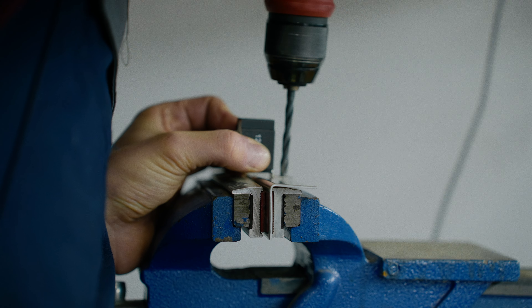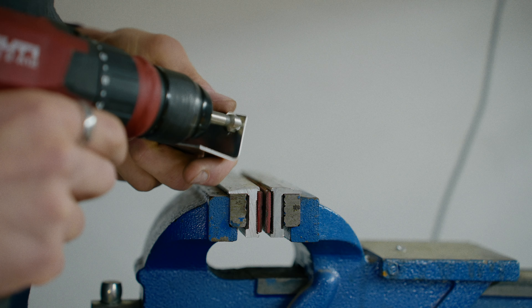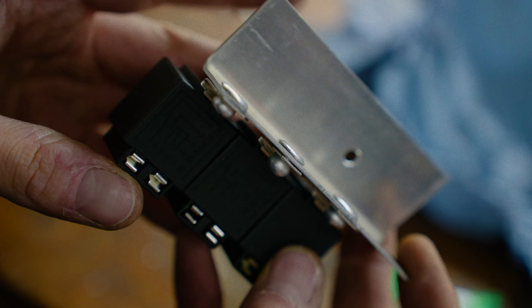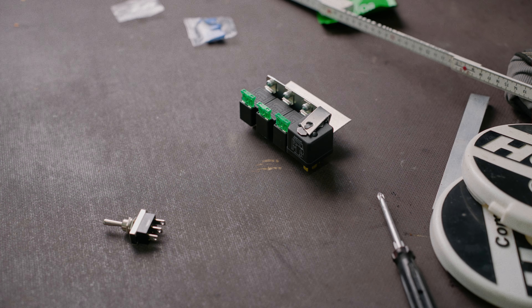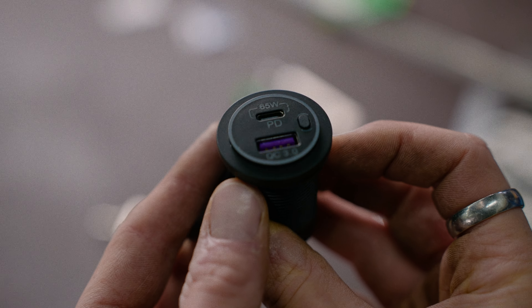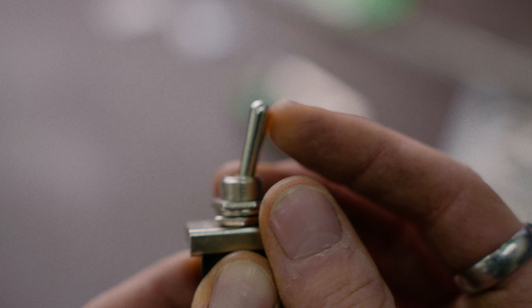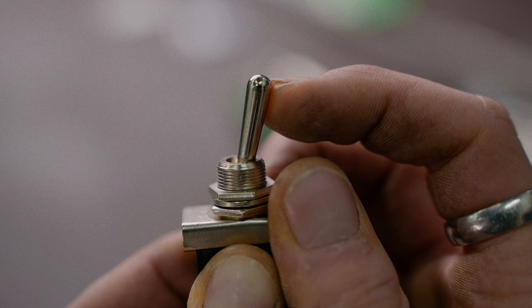The part that takes time is properly setting up the rest. I opted for three separate supply relays and a fourth to utilize the rear wiper trigger as a switch for the lights. The third supply relay provides power to the auxiliary electronics — namely a proper hidden USB charger and a standard 12-volt socket. The switch is an on-off-on, which enables the system to run either via the ignition key or via the battery directly if the car is parked.